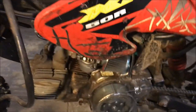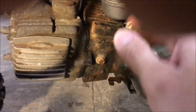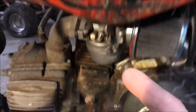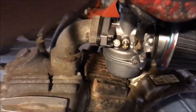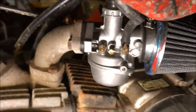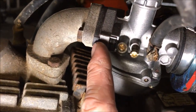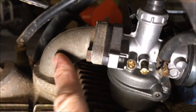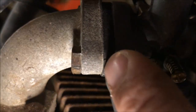It's getting air from somewhere it's not supposed to be. When you close the choke, the choke restricts air into the carb and helps balance it out a little bit. What often happens on these — there's a plastic spacer coming out of your engine, you have this 90-degree neck, and there's a plastic spacer between the carburetor and this neck.